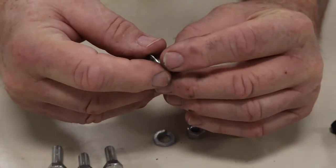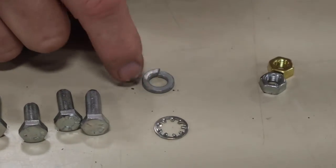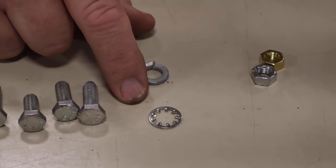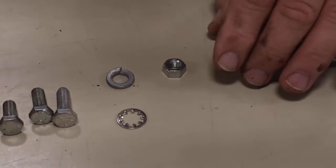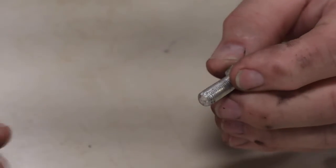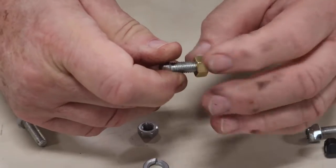The star washer will keep that bolt from spinning — it's a really cool trick for reinstalling some nuts and bolts very quickly. These are the two common types of lock washers you would see in the car. An external star you do not see; external stars are used for electrical work. There are a bunch of different types of nuts. Here we've got just a normal five-sixteenths nut — half an inch on the outside, five-sixteenths 24 on the inside. Here we have a brass nut.